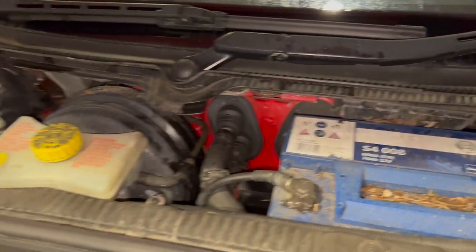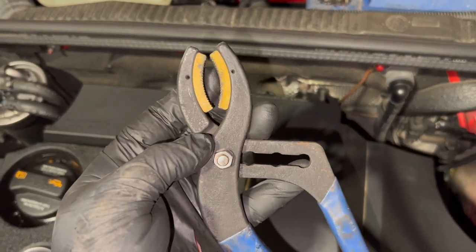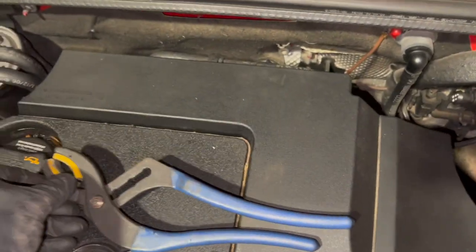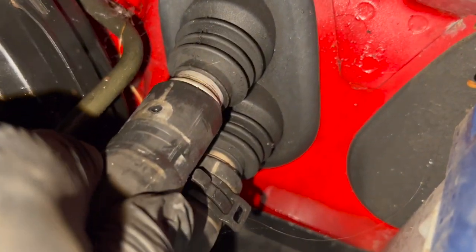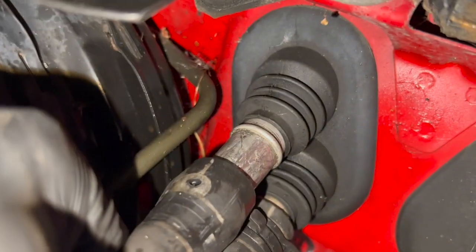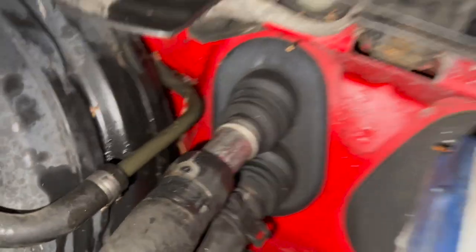So that's cracked off now - it did just take quite a bit of working, sometimes coolant pipes get on really tight. I've just got a pair of these soft-grip pliers especially for water pipes - it just means you can grab them, they've got soft jaws so they don't damage the pipes. I tend to find if you use something else it can eat into the pipe, especially if you're working it quite a bit. Now all I'm going to do is just pull it back - sort of about that point there. Just take a little while for the coolant to push around.